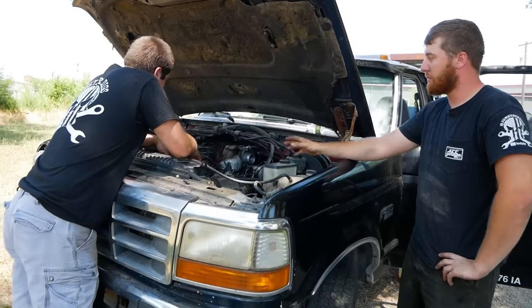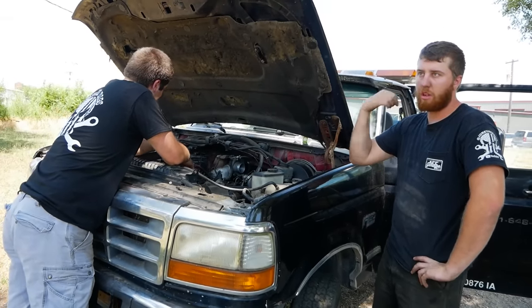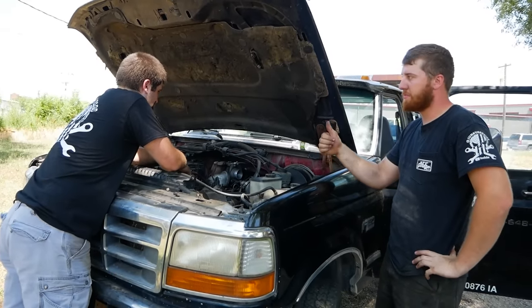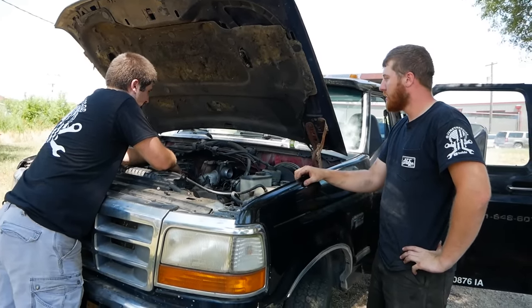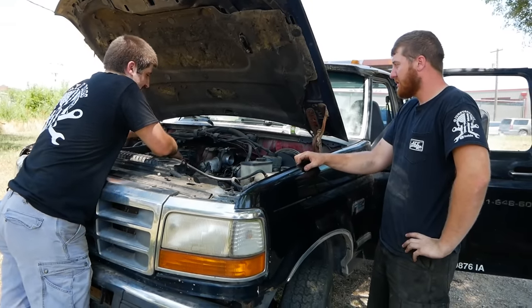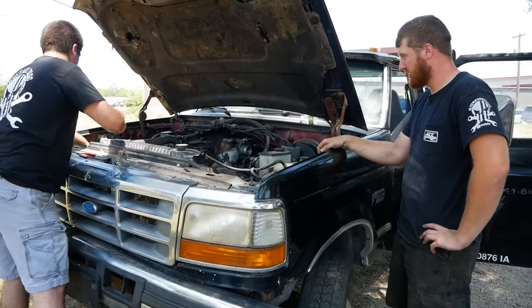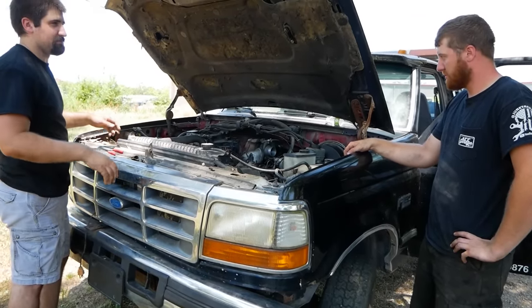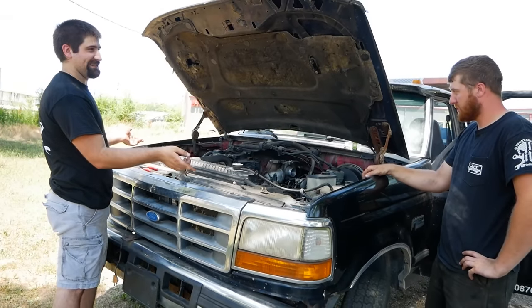So what we can do, if this starts working, so we're not just pumping all our fuel into the tank, is get a piece of soft line over that rusted out stuff and maybe use the tank. That's a good possibility. Or suck it dry again. What we can do to blow some of the stuff out of the way, old-fashioned way, is before I put any oil down the cylinders, we can put the batteries in and just...